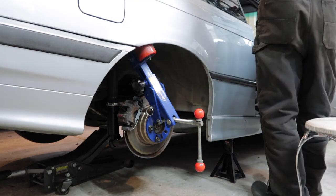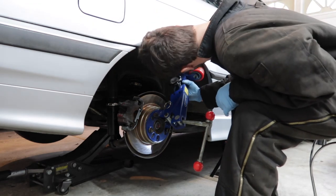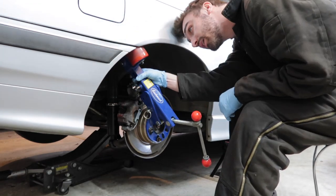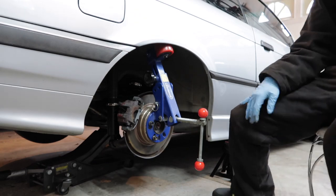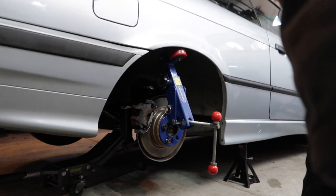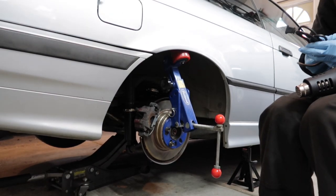Break the car out of gear - okay. Let's see what kind of motion we got. I think it's actually perfect. So that's good. Before we start actually rolling we got to heat this up or else you're going to crack your paint. You could also use a hairdryer but in my mind a hairdryer won't get this hot.